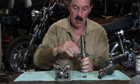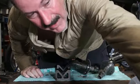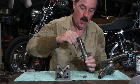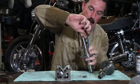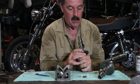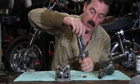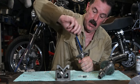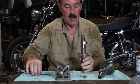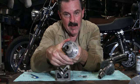the screws in here, and they're being a pain, so we will get our Allen key and try again. Of course, to put these in, you have to get the alignment just right. And that's the whole point of it, is that once these are in, the cam cannot move on the sprocket. There. Now, cam can't move. I can even take the one out that's in the slot. Not that you would, but this is just for demonstration purposes. And the sprocket still can't move on the cam.